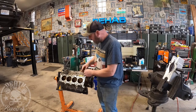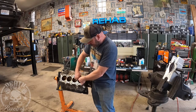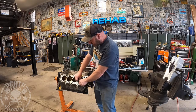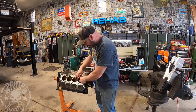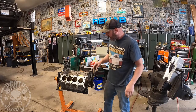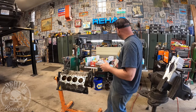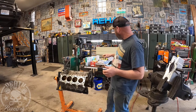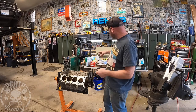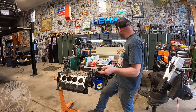All of that was because of ring gap. Just taking a couple thousandths off is going to keep that from happening again. We're only going to be pushing 400 horsepower, and I believe the rotating assembly can handle that. It got really expensive in my shopping cart and really delayed on time, so I couldn't justify it. It's a budget build — $250 block, about $300 in parts replacing the oil pump and timing set, plus gaskets and a high-volume oil pump.